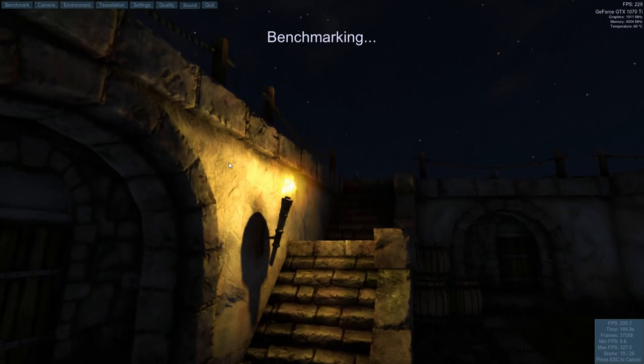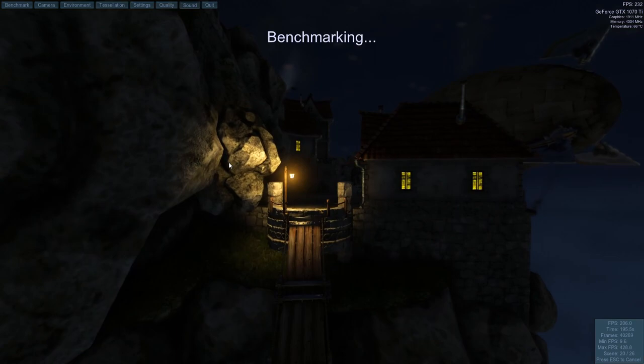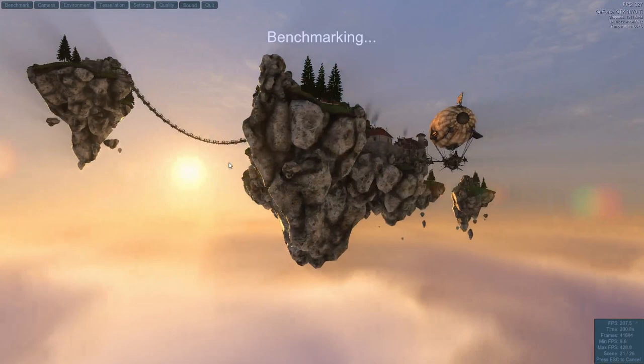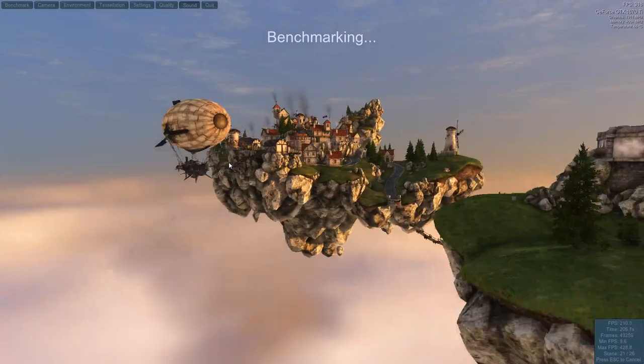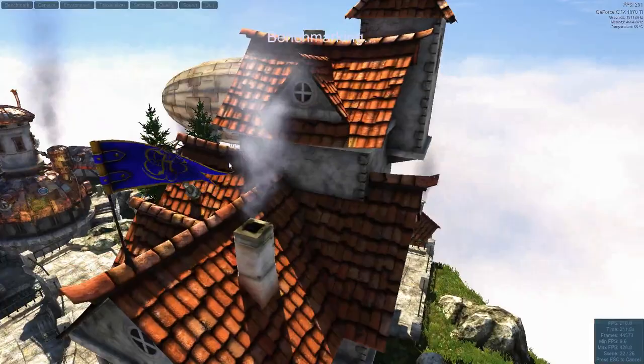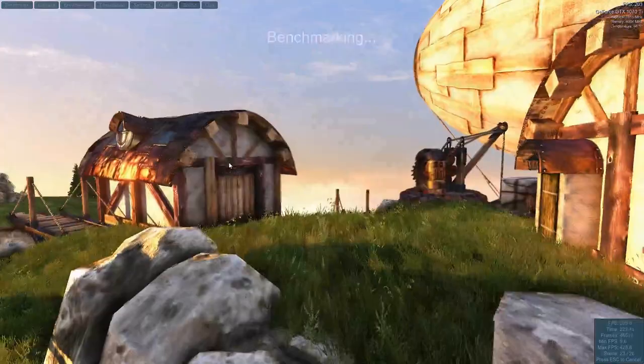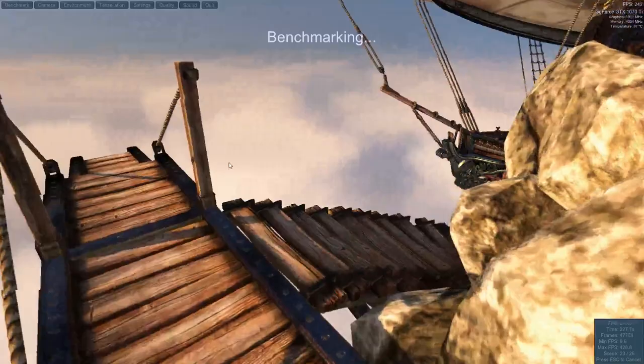Wonder how much power we're drawing from the wall right now. 250 watts, 268, 273, 238, 269. Oh, you better get that 750-watt power supply. Nope, not so much. The reality is, if we ran Prime 95 and everything at the same time, I don't think we'd break 500 watts. And even then, it would just be for a moment and it would drop back down. Although that would be enough to blue screen if your computer tried to draw more power than your power supply could provide. But we're running right around 250, 243, 242, 255, 260, 264,